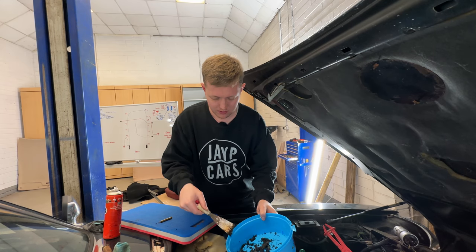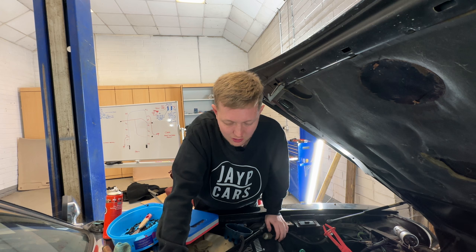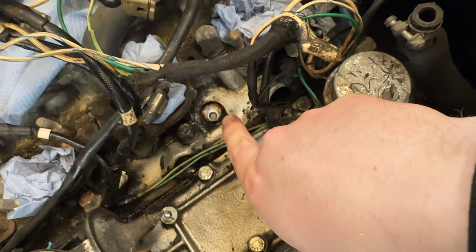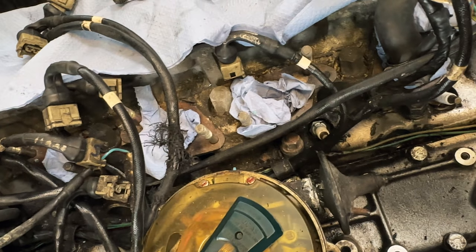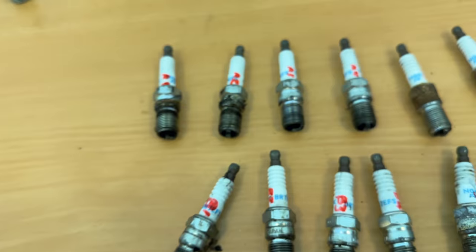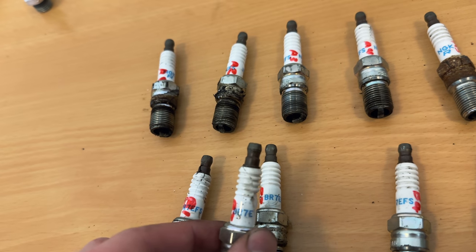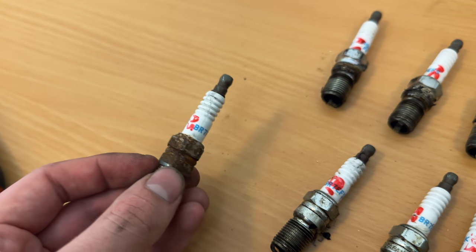It's not perfect, but I'm just not that interested in it being 100%. One thing I did notice is this spark plug - it was changed about 18 months to two years ago and that is looking horrendous. I don't quite know why. Just from a quick look they look absolutely fine. Why is that one like that? I'm going to have to replace it. Look at the state of that one. So having seen that plug that looked a bit funny, I've taken them all out - all 12. Look at the state of these. The plastic, the ceramics - they've all just shot up from the ceramics being destroyed. I just don't understand what would cause them to be like this.